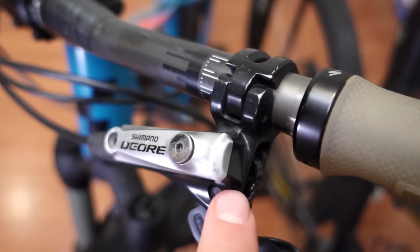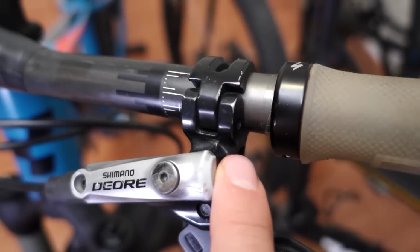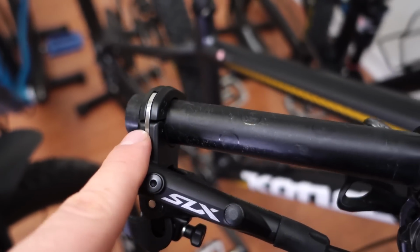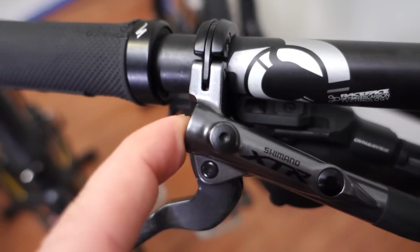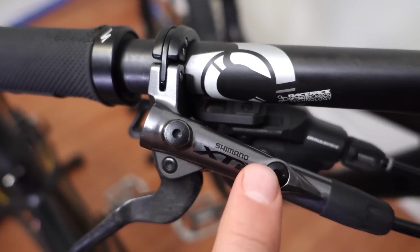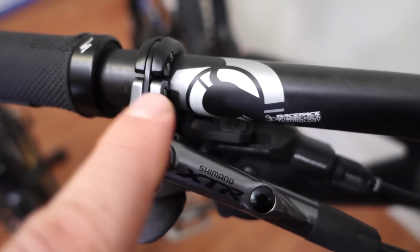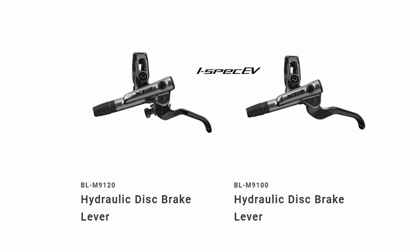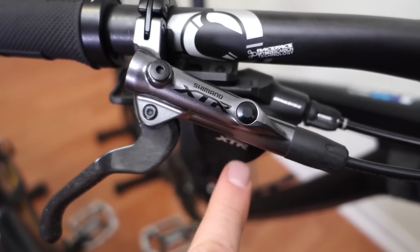One last thing about brake levers is the installation, and you see the iSpec B bar clamp used in the past. Then all these new ones use iSpec 2. You can see SLX, XT, the new Deore, and the XTR. I've covered all these in the installation videos that I have on my channel. But the new XTR 12-speed, the M9100, has moved that bar clamp here somewhere in the middle of the brake lever, and now it's called iSpec EV. Obviously, that wouldn't be compatible with any of the previous generation shifters.